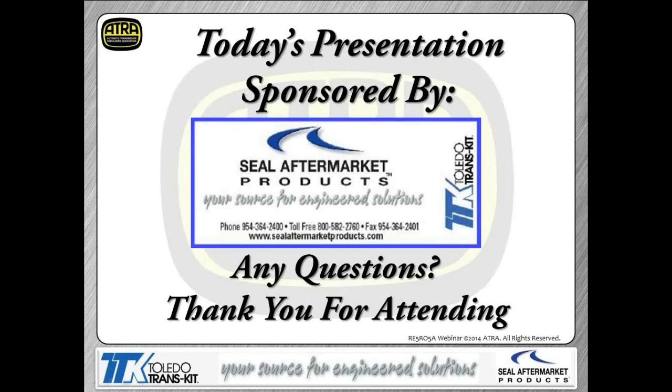So let's talk about planetary assemblies and interchange. There's quite a few differences in tooth counts in some of these items. For example, we have here the input shaft. Either length, short or long, could have either one of these tooth counts. There's only about 4 teeth difference between the two, so putting them side by side might not be an easy way to identify it. You may have to count all the teeth on it.